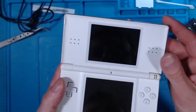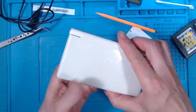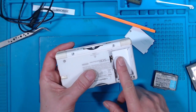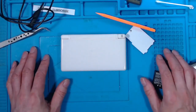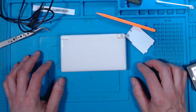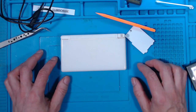So that was £11 — quite a good buy. So there you go: if your Nintendo DS Lite comes on with the charging orange light and then goes straight off, check the fuses. First try a new battery, make sure the battery is working. If it still doesn't work, get it open and check those fuses first. Thanks for watching, I'll put this back together and I hope to see you in the next one. If you've got any questions about Nintendo DS Lites leave them in the comment section. If you like the video please like and subscribe — I've just passed 300 subscribers so I'm well chuffed. Thanks for watching and I'll see you in the next one.